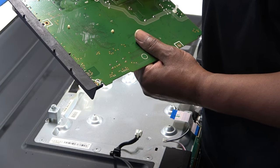Okay, close it, plug in my speaker, and our power cord, while I'm making sure that the other side of the power cord is not plugged in. Okay, we've got our two new capacitors installed. And on a curious note, I'm always going to check, because those are the capacitors for our B+ for the LEDs. I'm going to recheck it and see what it's supposed to be, and hopefully it comes on and stays on. Okay, got it plugged in.